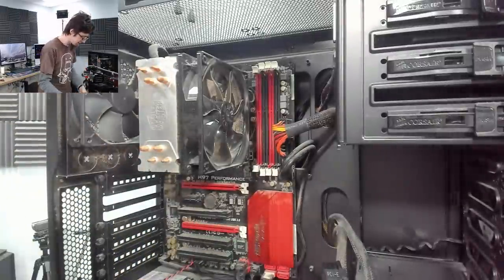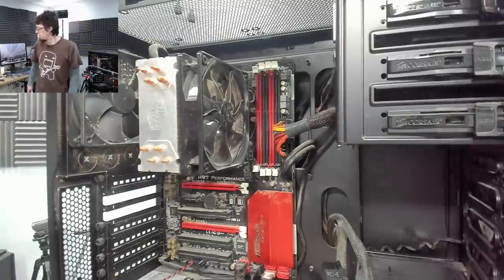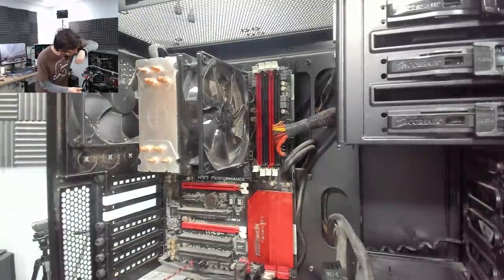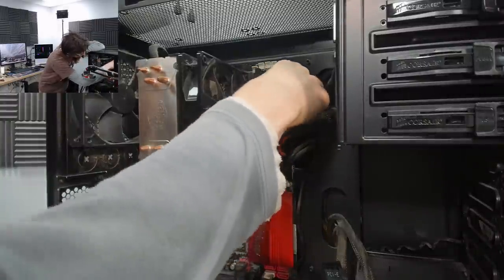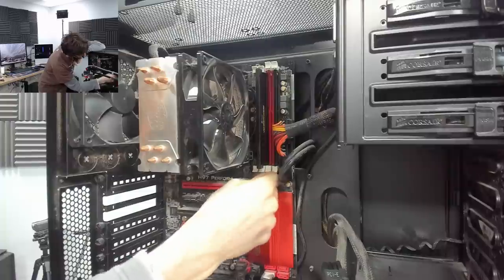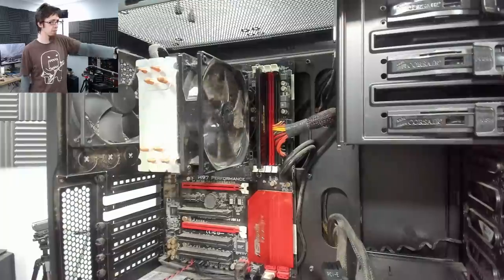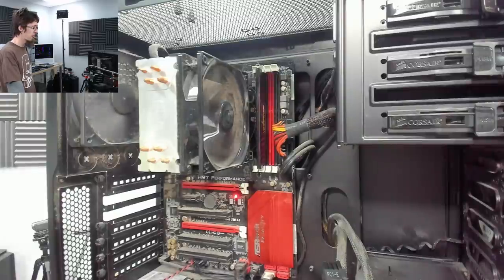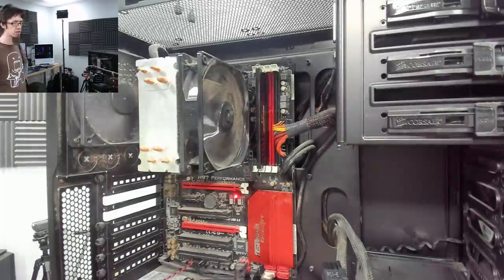They're XMS3. It's pretty dusty in there — I wonder if this thing is just a dust problem. First, I'm going to drop in this known-good memory module that's come out of a board I know runs. Power on. No beeps. I'm going to go make a coffee while I wait, just to see if it RAM trains or something. So it didn't beep, but it hasn't posted either — a bit odd.